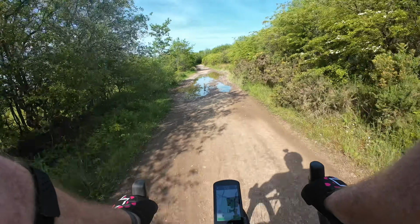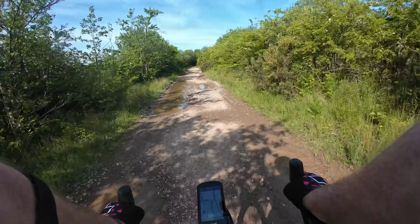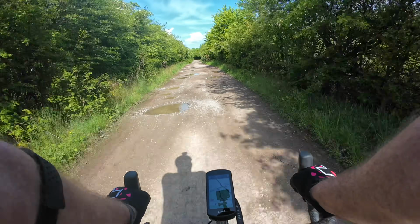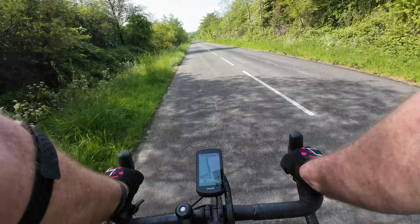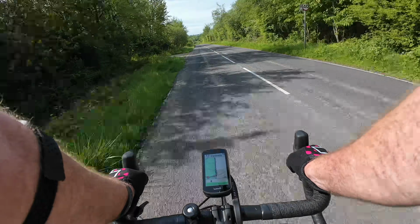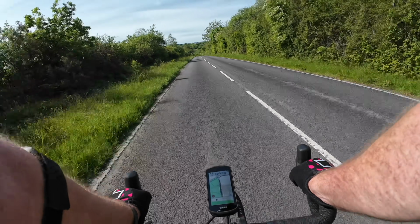Just for reference, when it comes to seating these tyres, these are 45mm and the rim bed on these Hunts is 20mm. Once I'd got the tyres seated, I took the valve core out and filled them with sealant. Muc-Off reckons 60ml, so I put 70 in, using a syringe through the valve.